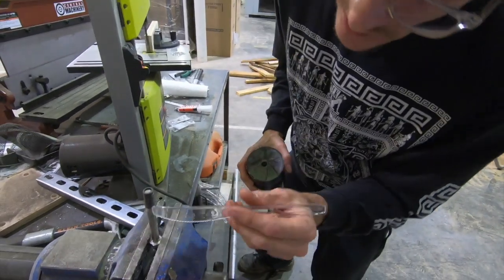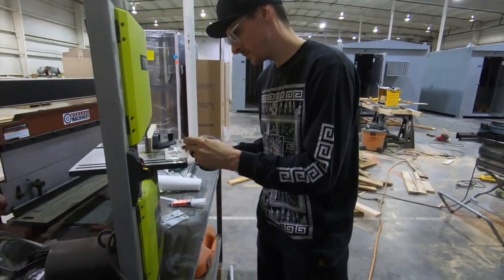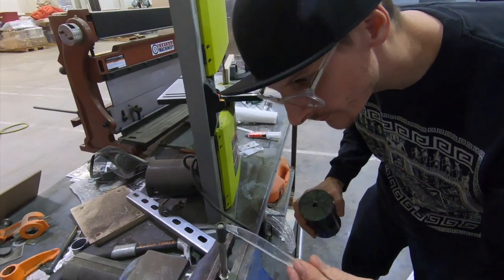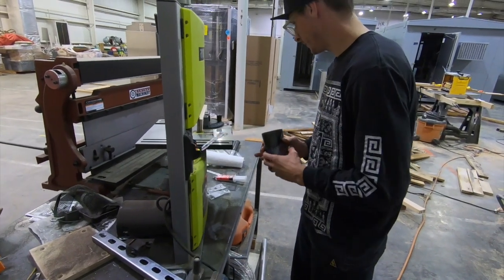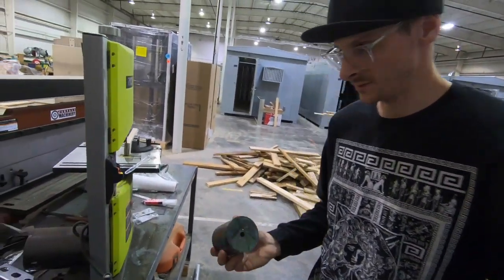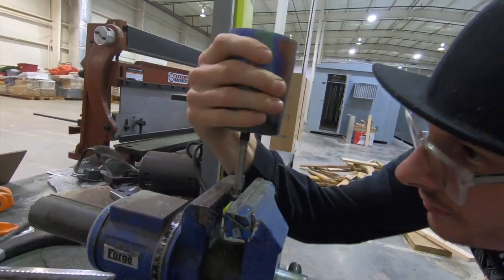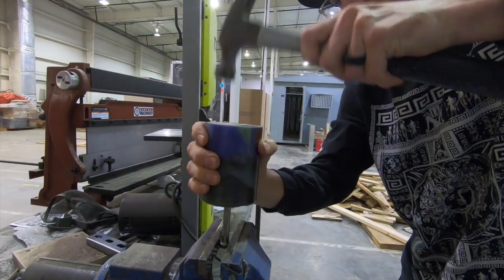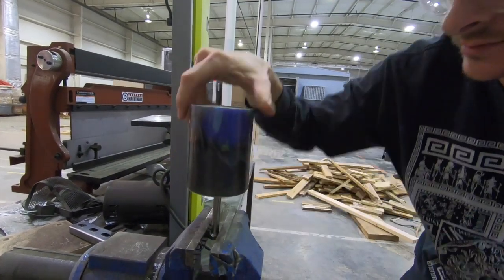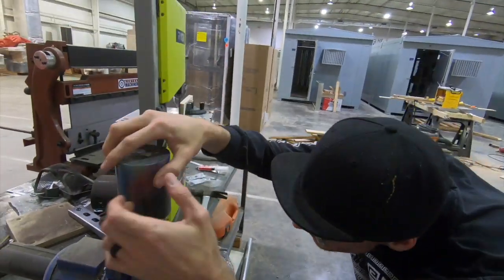Nice. And the insert that I'm using is a Time-Sert, 10 by 1.5. We'll link that down in the description so you guys can see. Same thing with the JB plastic weld. These are usually used for replacing head studs in a motor. Oh, okay. Kind of like a Helicoil? Yeah, these are like the super Helicoil. And just kind of start here. And just like that. It's not perfect in there, is it? It's in there. Oh, it's in there. It's not as centered as I would like. That's okay. That's the point.